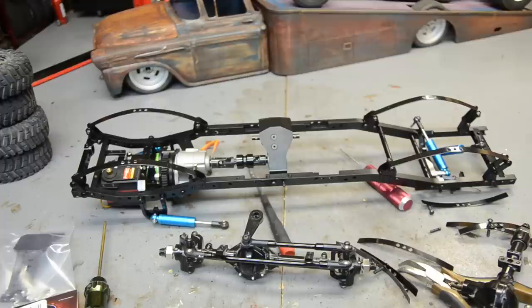We'll probably use the basic ESC on this. It already has the Axial 35-turn motor on it. I also have the RC4WD 35-turn motor that was in that as well, and the standard Twister high-torque servo. I've got several of those. I'm out of spare Savox right now, so they're decent - not fantastic, but not nearly as noisy as those Savox I had were. Like I said, leaf springs - I'm just gonna set it up basic at first. I've got the red soft leaf springs that RC4WD offers but I'm not going to put them on right now until we get the rig fully built and running.